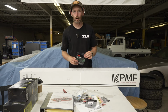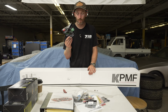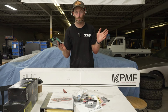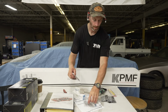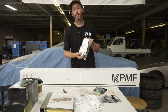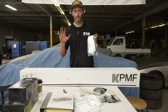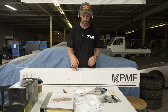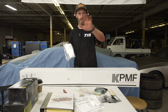If you've never wrapped a car, there's a bunch of things that really help doing it. Knife tape. This creates those smooth lines in the separations of the material. Good razor blades always help. Squeegees. I didn't realize I ordered that many. Gloves. The gloves are clutch because your hand has oils and it's kind of sticky, and you have, you know, like gecko hands, and you have ridges on your fingerprints and stuff. These help lay that vinyl down really nicely.